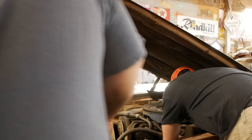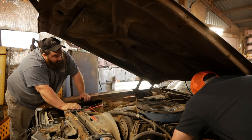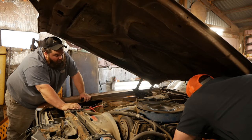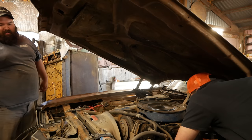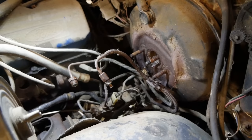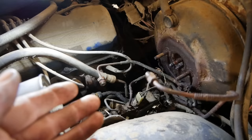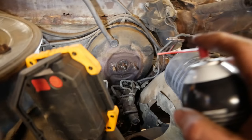Will our luck continue? That's pretty rustic. I do have to say, I like the Roadster aspect better than the convertible. I was pleased and it made sense when that was pointed out. The problem here is that the new master cylinder has ports on the wrong side. If we just conveniently move these to there — that's working way better than I thought. We just have to cut the end off and put the correct tube nut on. This one might go right in as-is.